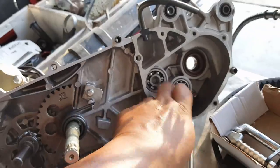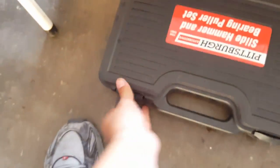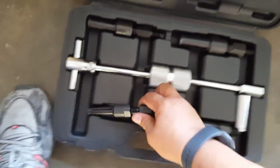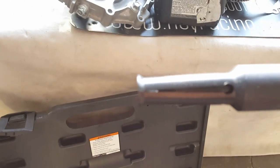In order to remove this kind of bearing set, what you'll need is what's called a slide hammer bearing puller. You can get them at Harbor Freight. They come in a set like this, and you can remove the bearing easily with them. They come with an open lip that you can expand — you find the lip size that's right, and when you bolt it in, it expands the lip so that little lip part hooks onto the bearing to pull it out.